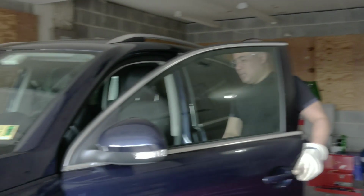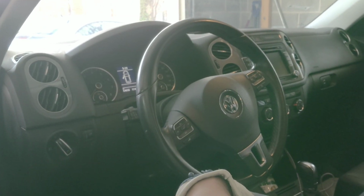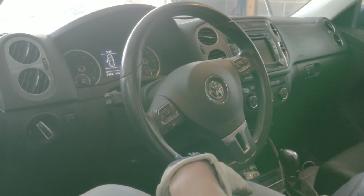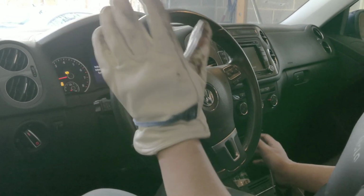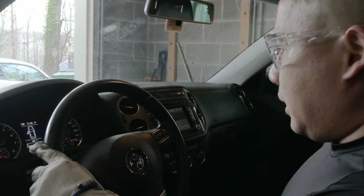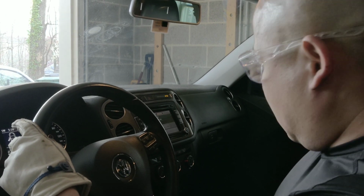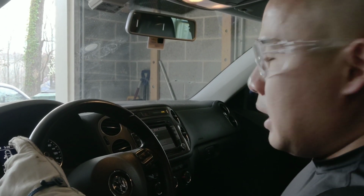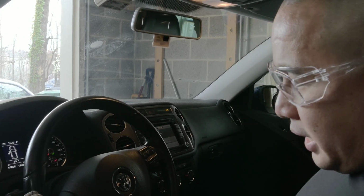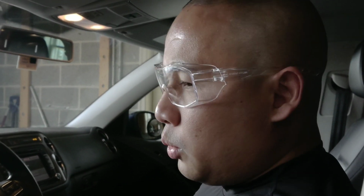You want to come here, Brennan. Don't drive the car. You have to keep pressing the brake. Never ever drive the car, okay? Bleed the brake. So the piston will go back into position. Now it's good. You feel it? Make sure you press the brake pedal and then put the brake piston back into the regular position.